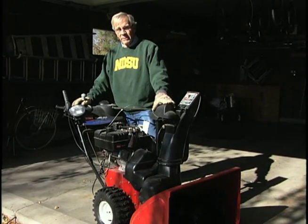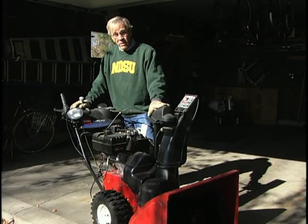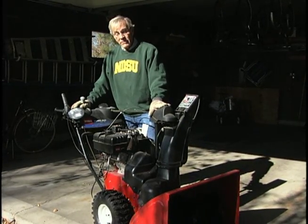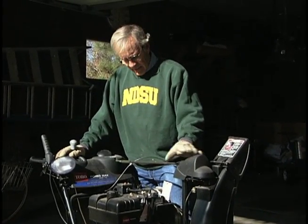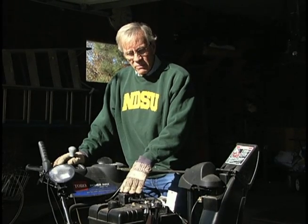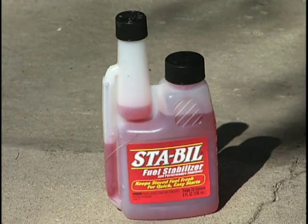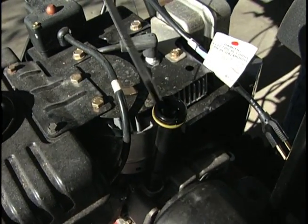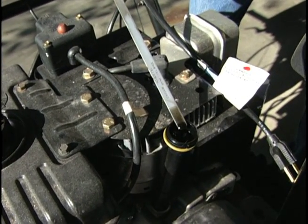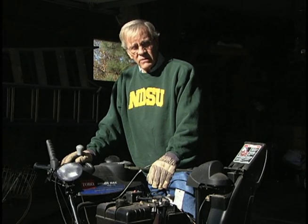Although it seems early, late October is a good time to get your snowblower prepared for the oncoming winter months. We don't use a snowblower as often as a lawnmower, so it needs particular attention. If it sits all summer and through most of winter with little activity, the gas will get old and stale — that's where a fuel stabilizer comes in handy. Also, condensation can accumulate in the engine during storage and dilute the oil, creating problems and shortening the longevity of these machines.